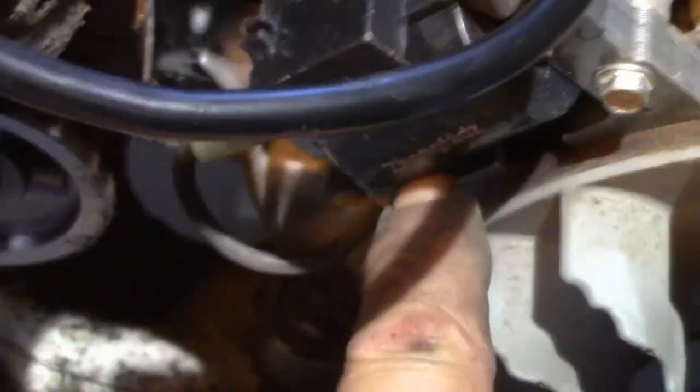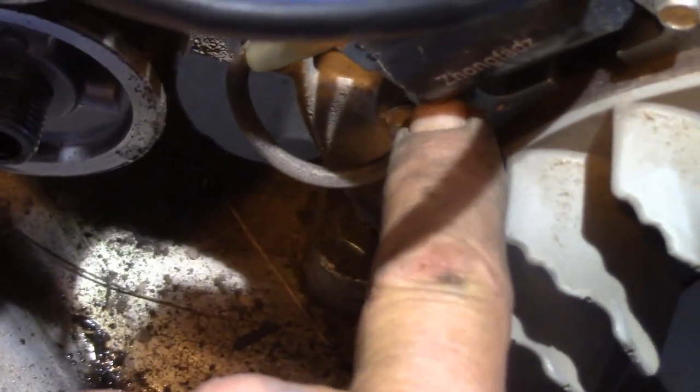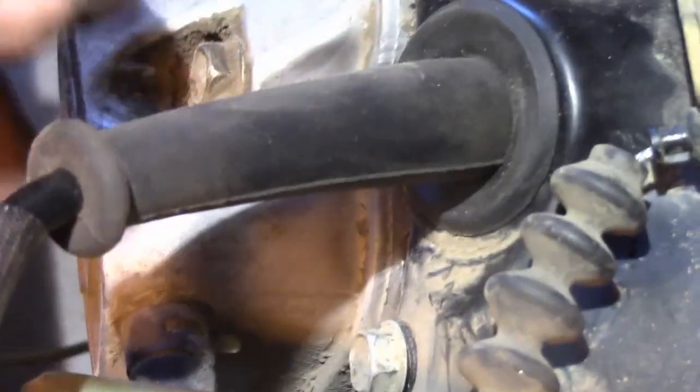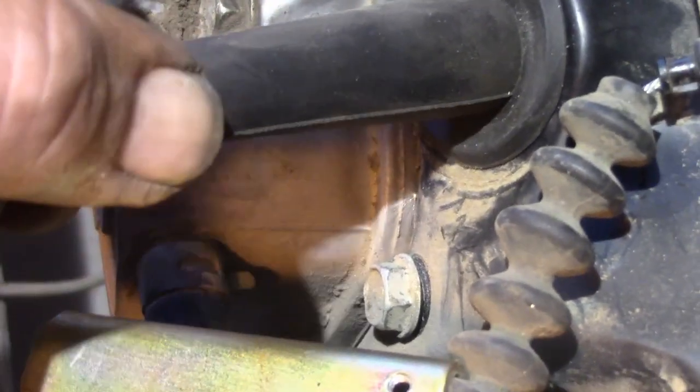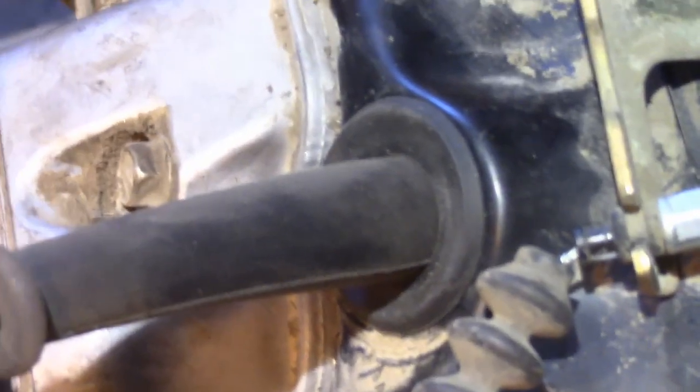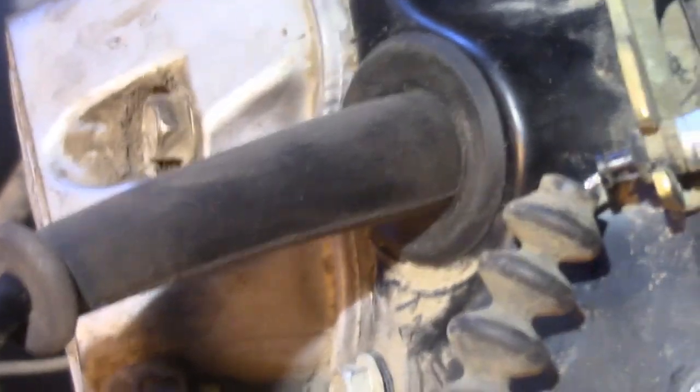I have got my coil installed. Now there are two bolts, two little machine screws — 8 millimeter heads. For the spark plug boot, this coil came without one, and it was a right angle boot. I changed it to a straight-on boot because that's what I had laying around. You don't have to have a boot on. Old-style small engines in the old days didn't have boots on the spark plug wire — there'd be a tab of steel that you'd touch against the spark plug to ground out the spark. That's essentially doing the same thing as this kill switch wire, just in a more crude fashion — it just grounds out the ignition.